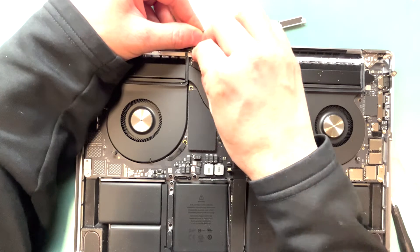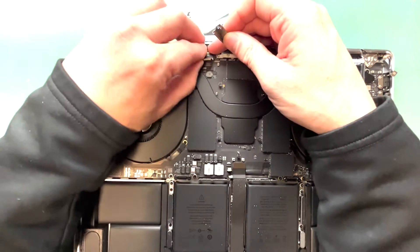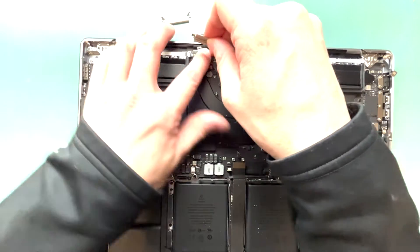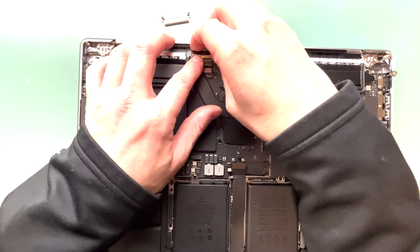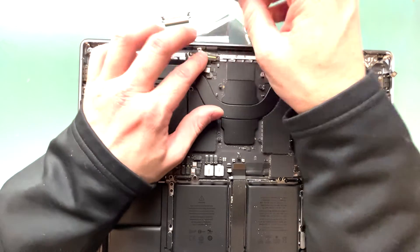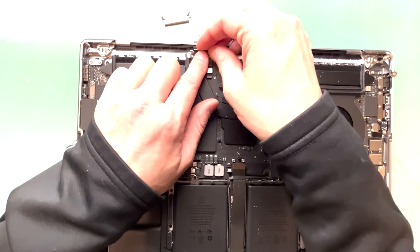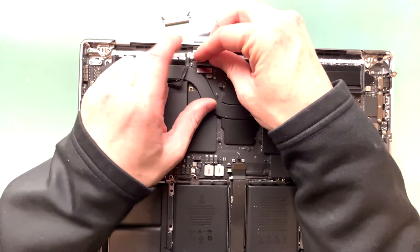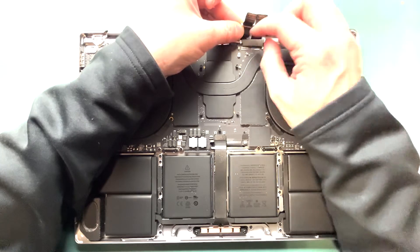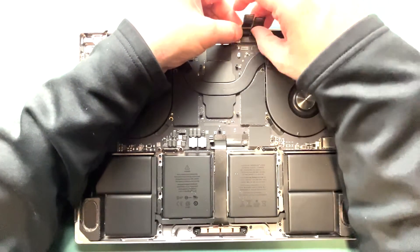After closing the laptop lid once it's screwed together, you'll want to route the cables carefully — map them through and stick them around. This is very difficult; I've spent 20–30 minutes sometimes per repair just getting these cables right. They can get bent and you have to re-bend them back so they'll clamp on. Push the bracket over the top on the back side and push it downward. Most importantly: do not screw through the ribbon cable — that would ruin the over $700–$800 screen. Pay close attention to detail here.